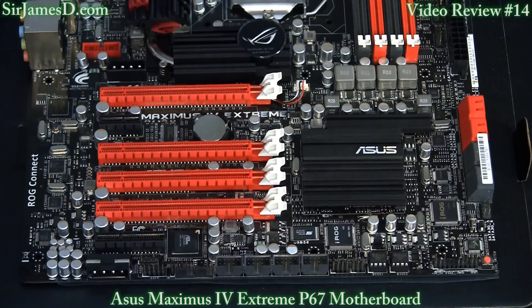For PCI lane configuration: with a single card in slot 1 you'll be running x16 native. With two cards in slots 1 and 3, it runs at x8 native. To engage the NF200 you need a card occupying slot 1 — a graphics card, sound card, something — and then graphics cards in slots 2 and 4, which will then run at x16. Later I'll present benchmarks comparing the Intel native x8/x8 versus the NF200 x16/x16.